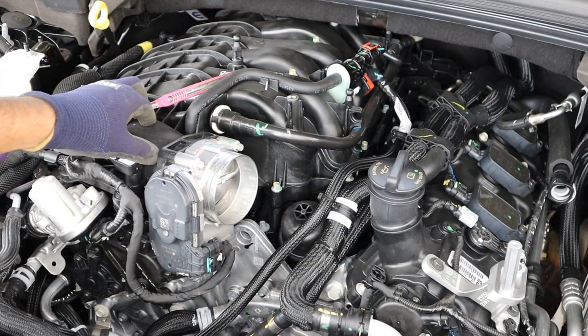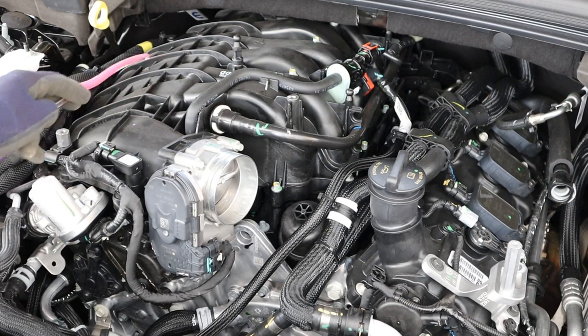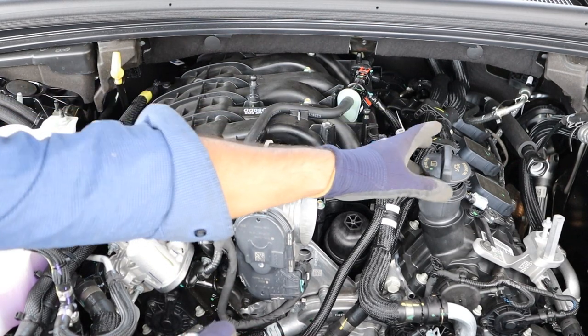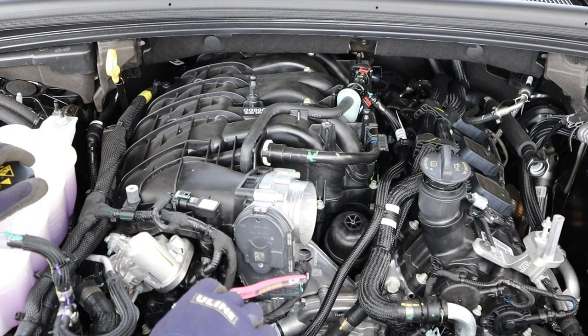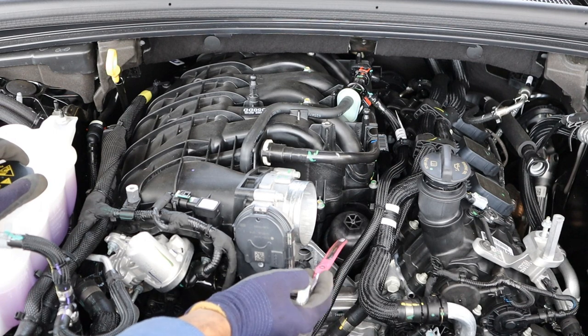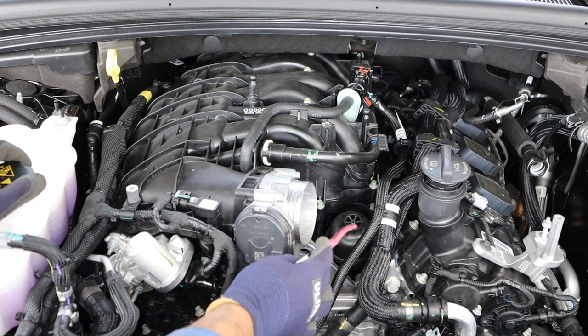However on the passenger side it is buried under the intake plenum like most V6 vehicles, so you're going to have to remove that to access the spark plug. Taking a look at the lubrication system, this engine uses 0W-20 weight oil and the dipstick is conveniently located over here. What's most interesting is the placement of the oil filter down in between the V of the engine — there's a plastic housing you remove with a cartridge style oil filter inside.